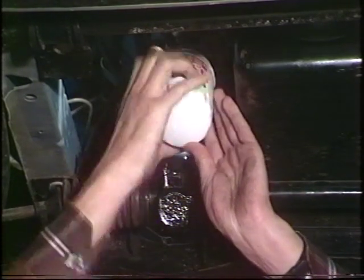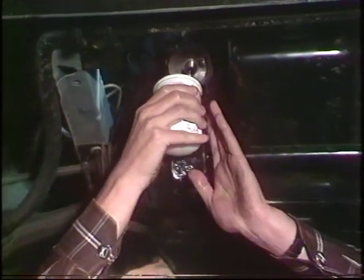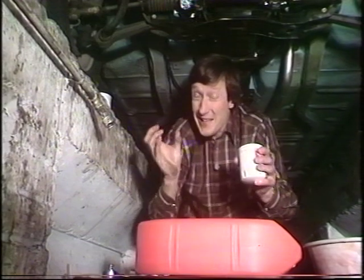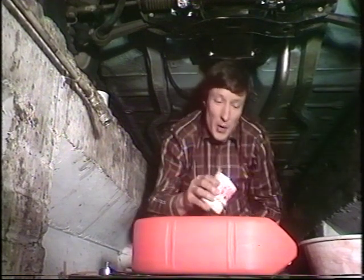You often have to make some sort of tourniquet to help unscrew the filter. It's a cartridge type on this one — more and more popular, increasingly used on cars, replacing the replaceable element type. Beware when you take it off as it's full of oil — up to about a pint.